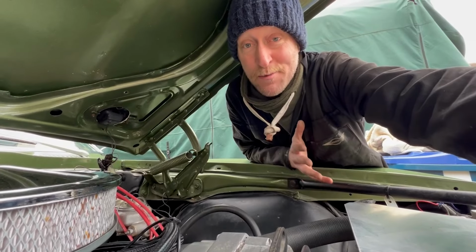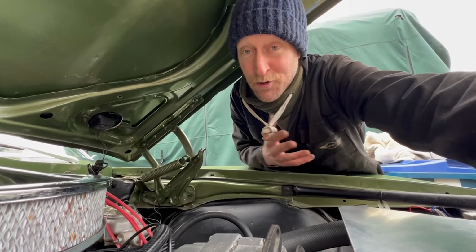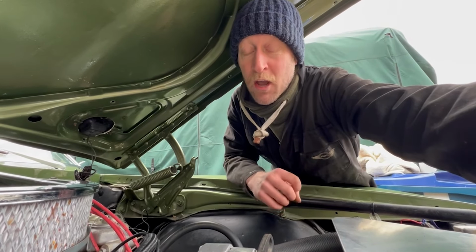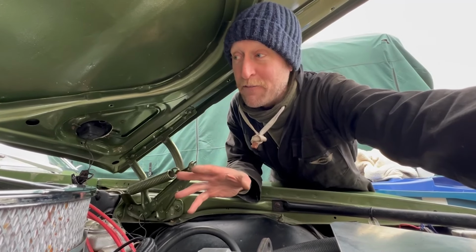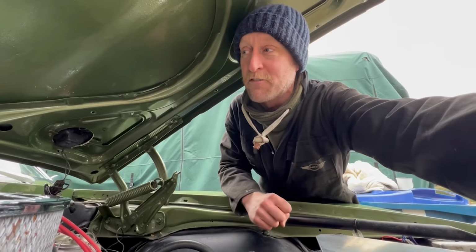And I haven't done it once. I've done it twice. I've done it three times. I've done it five times just to make sure, because I'm a bit like that. And I do trust my work, but always safer than sorry. So I've checked all the hoses. Also, make sure when you're starting it, because you've been using tools, make sure everything's free from the area, no loose wires, make sure the fan belt's free of all other items that you possibly might have left around.